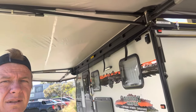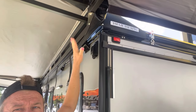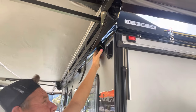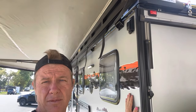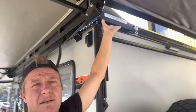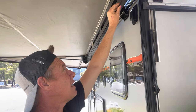James from Isolated Industries pointed out that he quite liked the existing standard mounts already on the camper. They don't provide any anti-flex but they do provide quite good shear strength — good holding strength when driving over bumps. There are four of them on there. Anti-shear front and back is handy if you bump a tree or rub against a telegraph pole when parking. The twist strength is dealt with really well by our hook and triangulation brackets. Overall, this is probably the stiffest and strongest solution for these campers without loading up the walls and risking damage to the vehicle sides.